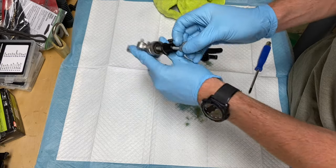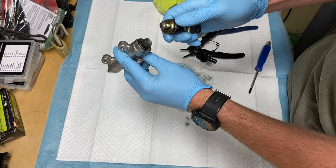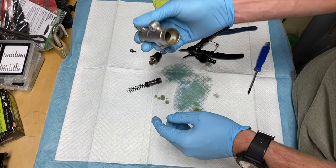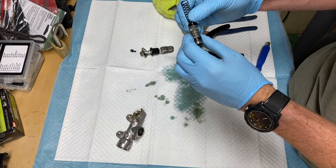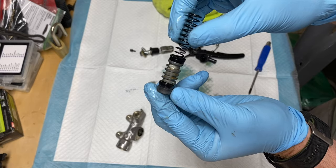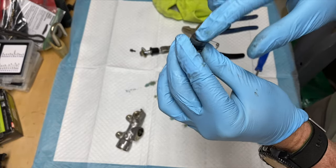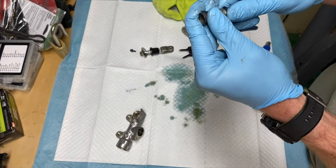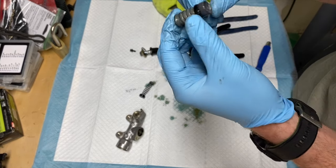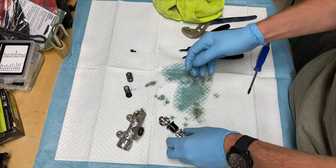For this project you will need snap ring pliers to get this part out. You can see the piston is not in very good shape — there's a bunch of gunk kind of calcified on there. There are kits you can buy that include a brand new piston, around $40. I didn't go for one of those thinking the piston would be okay, and I was actually able to scrape most of that gunk off. The rest of the parts I inspected looked pretty good.